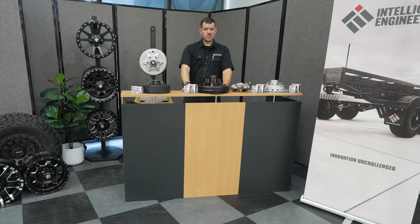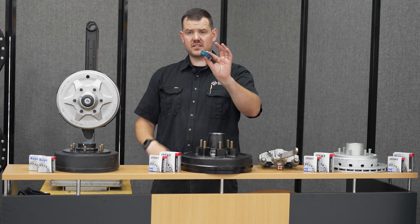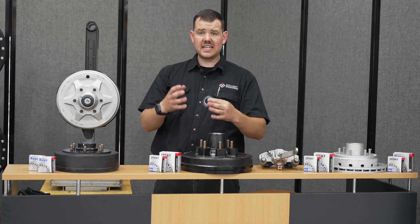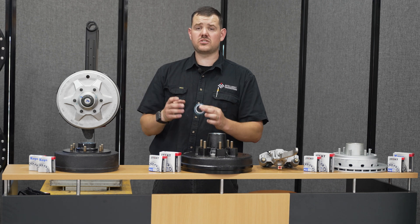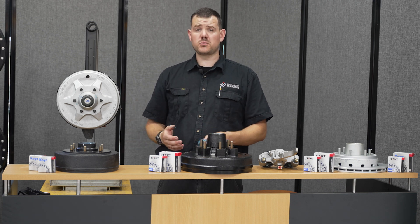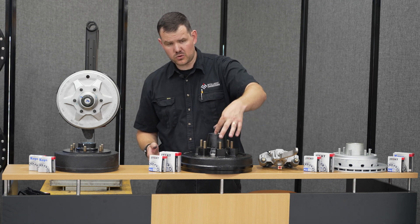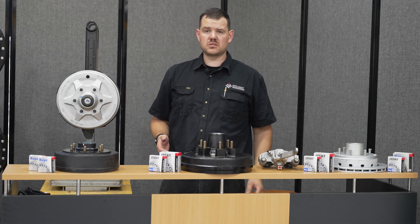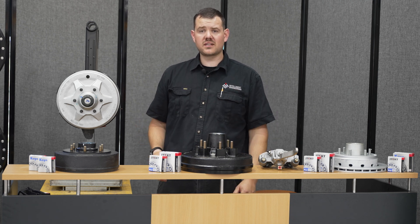When it comes to grease, it's very important that you insist on a lithium complex wheel bearing grease. The reason is that if the wrong grease is used, when it heats up you'll get oil bleed through your seals, causing leaking on the inside of your rim or patches on the ground, and the grease will disperse from your drum. Lithium complex grease will remain in place and do what it's supposed to do inside your braking system.